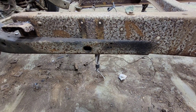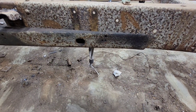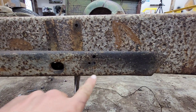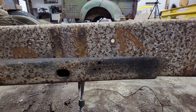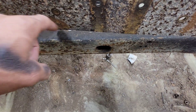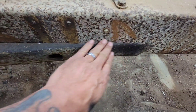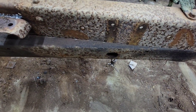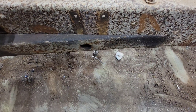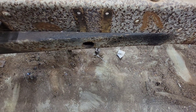I made my marks, got it cut and put in place — right now that's what it looks like. This is the front Nova subframe and this is the original frame. You can see a little bit of how it widens out right there. Later I'm going to box this so you can't ever tell there are two different frames put together. Anyways, I'm really liking the way it looks right now. We're going to take it all back apart, get all the metal cleaned off so it can be welded, and put it back together.